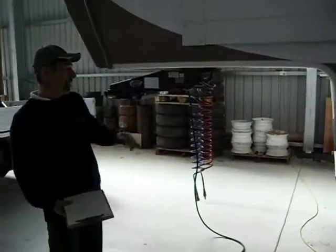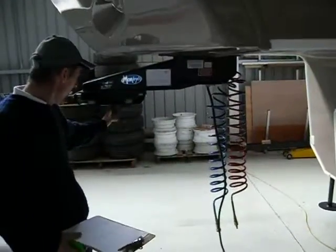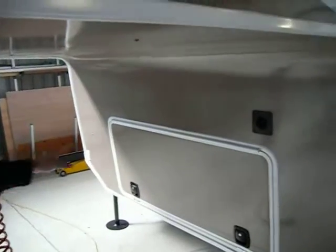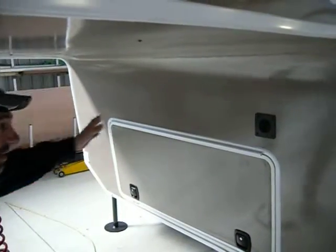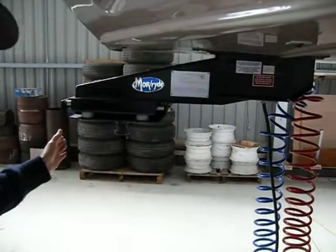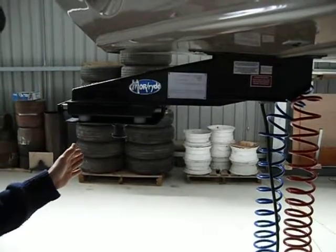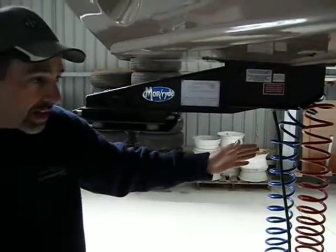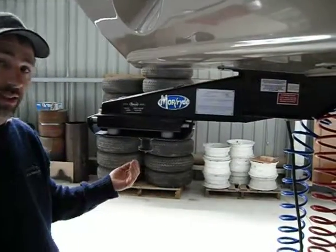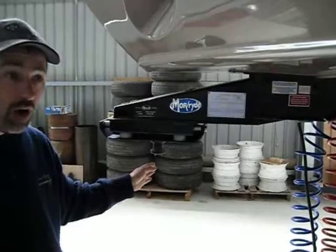The other interesting point with the front of the trailers is the kingpin position. From this point back to the transition area wall is 1900mm. If you're trying to get the weight in front of or at least on the rear axle of your tow vehicle and you want to articulate and spin the back corner of the vehicle around, you need a good length trailer. This is typical of a high-end unit or a high-profile trailer.